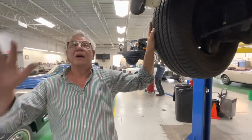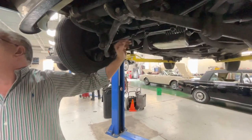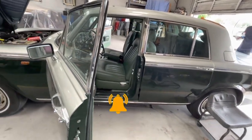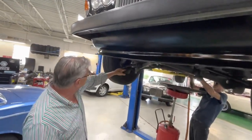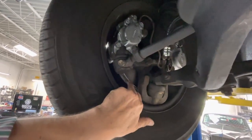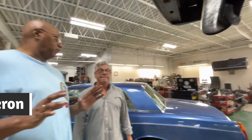I'm telling you what we do — and that applies to everything. We check steering racks. Shadow 2 steering racks are famous for leaking. If they're leaking, there you go. Brand new hoses, all calipers rebuilt, brand new rotors. A customer may want to save money — we might cut his rotors — but brand new rotors is what we do. When I'm looking at suspension and brakes, that's where I don't cut corners. Hydraulics and brakes — you should never cut corners. That's a safety issue.